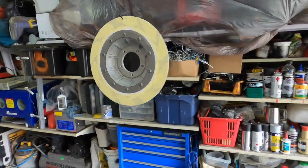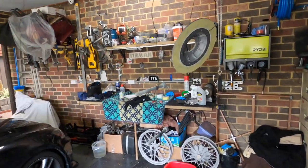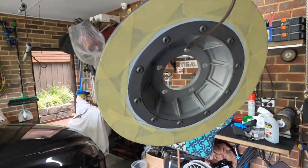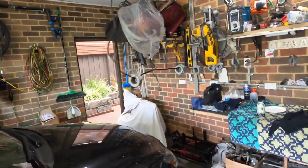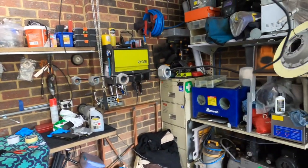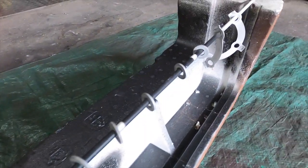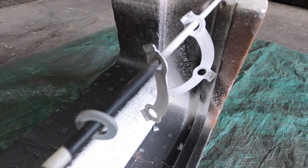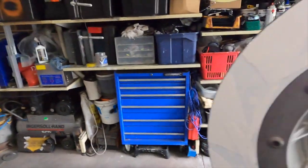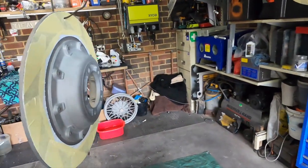We'll give that its acetone bath for about half an hour and then we're ready for remasking and Cerakote. I've got everything remasked up - masked it the first time, did the sandblast and clean off, remasked, got the bolts blasted and hanging. I've got the hanging nylon nuts for the discs, all the washers, and the lock-offs for the rear disc. It's time to get some color into this baby - I shall report back once they're straight.